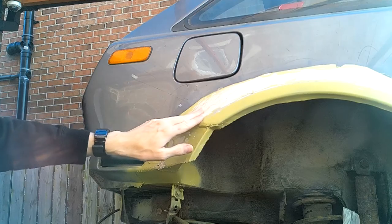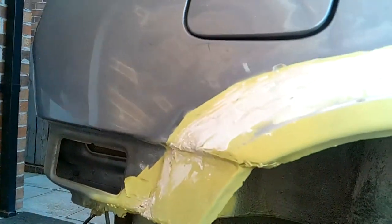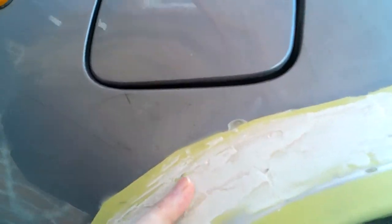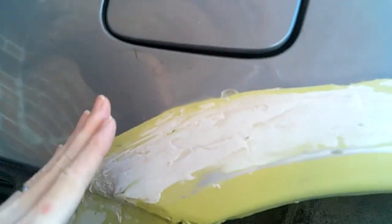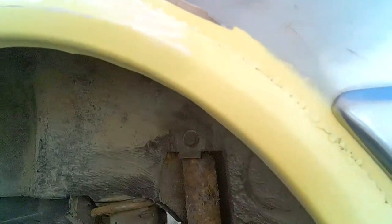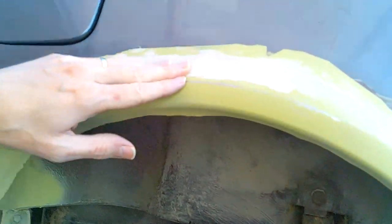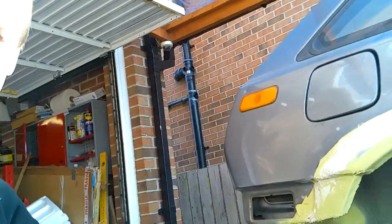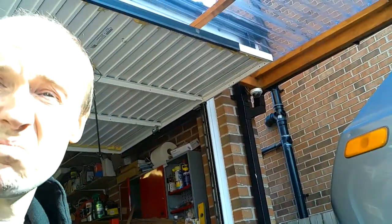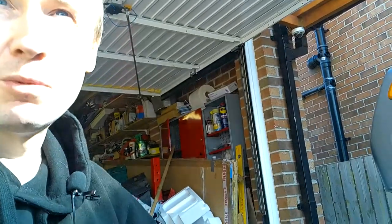Now that's feeling quite smooth but if I take you in a bit closer you'll probably see - it's quite difficult with it being so sunny - that it's a bit lumpy and bumpy. So what I want to do is smooth over that. Obviously these are the key bits as well where the welding is terrible but it's holding. Basically cover that over, smooth it off and then we should end up with something that looks half reasonable maybe. So let's go and mix the filler and give this a go.